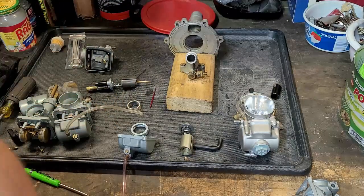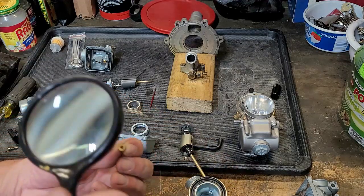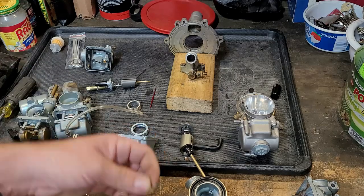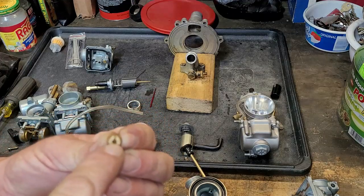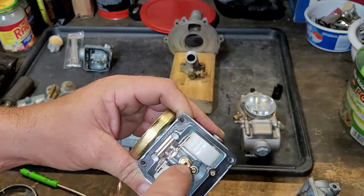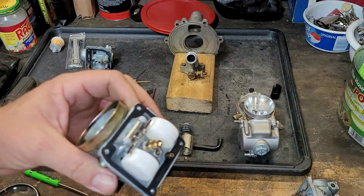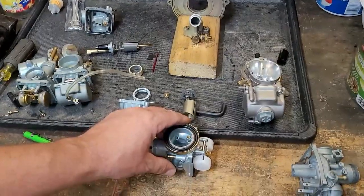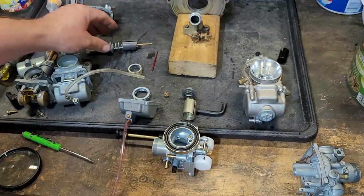Visually looking at it with my magnifying glass and comparing with the Mikuni, they are very close. But the drill bits don't lie — I couldn't put the 60 through the Mikuni 95, so this aftermarket jet is definitely bigger. It's got to be like a 98 or a 100 jet, which I'm perfectly fine with. We know the jet is adequate and we have sufficient airflow, and we have a better needle.